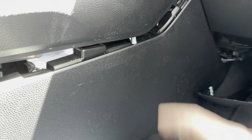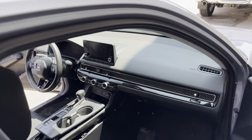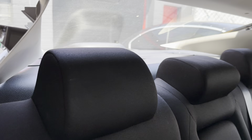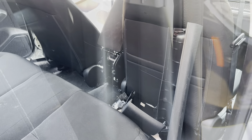If the airbags were deployed, most likely the driver's side seat belt is going to deploy and the rear ones are going to deploy too. This was kind of a first for me — I never realized that even if they're not used they could still deploy. You would have to remove the side airbags and seat belts. The rear ones are covered by a cover that you can pull up by removing clips.